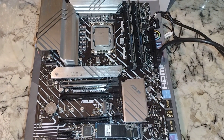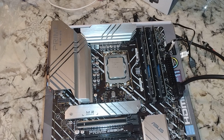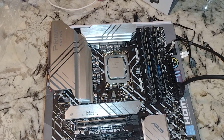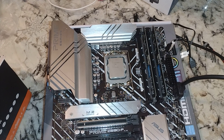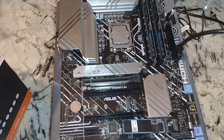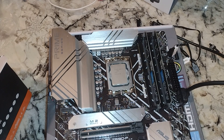In this video we're going to install a CPU cooler on top of this i7-12700F. I've been using the i7-12700 in an ASRock B660M-ITX — it makes no sense giving it an M name for micro ATX when it's an ITX board — but we've decided to put it in the ASUS Prime Z690-P and compare how it performs versus the old motherboard. That one had 4000MHz RAM; this one's going to have 4800, maybe 5000, whatever I decide to set it to.